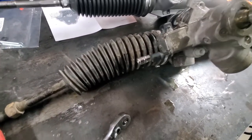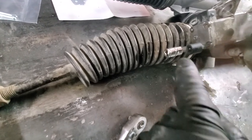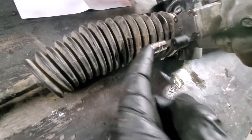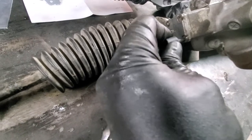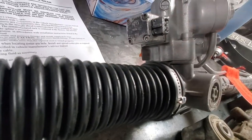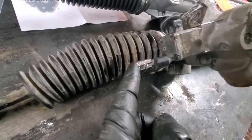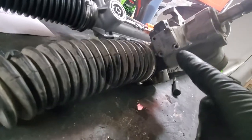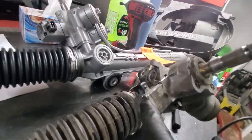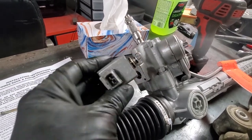To remove this electrical part — as weird as it sounds — there are two different types of bolts diagonally: a 2.5mm six-point Allen key and a T20 Torx. The other one seems to be all T20. Don't strip the 2.5mm Allen — I was able to get three out of four of those. The last one stripped inside.